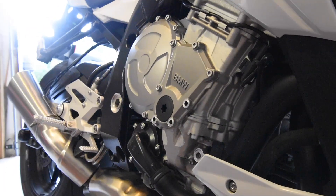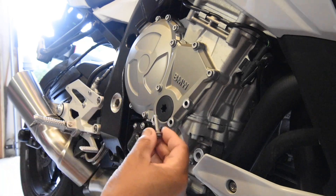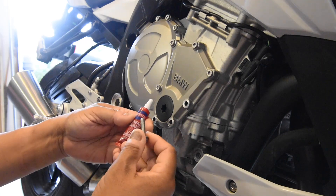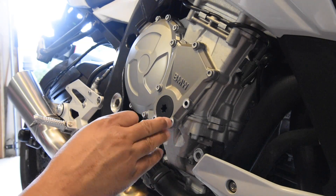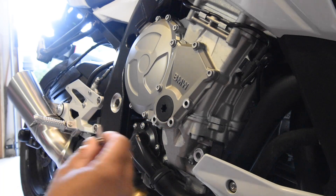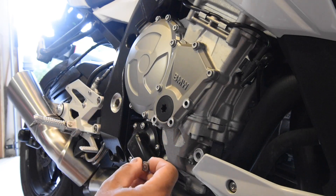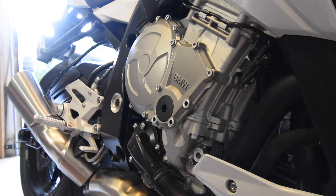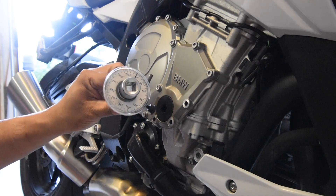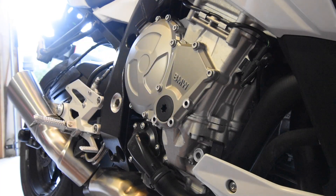With the old slider removed, I've got one of these M6 by 25 aluminum torque-to-yield screws ready. I'm going to put a little bit of medium thread locker on the tip, then torque it down to close that hole and provide the clamping force. The torque is applied in two steps: first, three Newton meters with a torque wrench, then 90 degrees using a torque-to-angle tool.